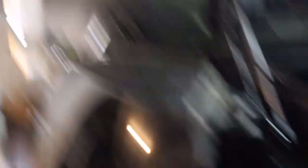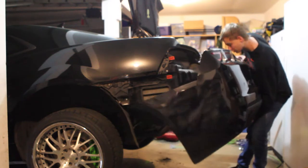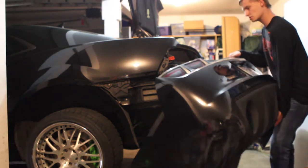I was able to pull the bumper off. What I had to do is once I pulled it out this way, I had to hold right here with my hand and pull on right up here. So the key is to pull like that — you hit the top, you kind of want to pull down on this, and this side pull straight back. But it was pretty tight on there. Luckily I got it sitting on the tips because these sit pretty far back. Same thing over here and I was able to pull it off. Now I just got to remove it and put it on some blankets so it won't scrape the bumper. I'll grab it at the center and walk it back. Nothing else is attached, so I'll set it on the ground — and there we have it.